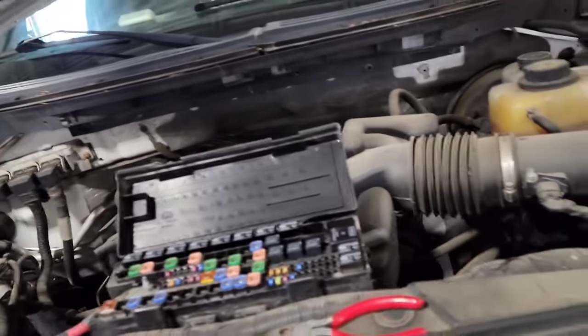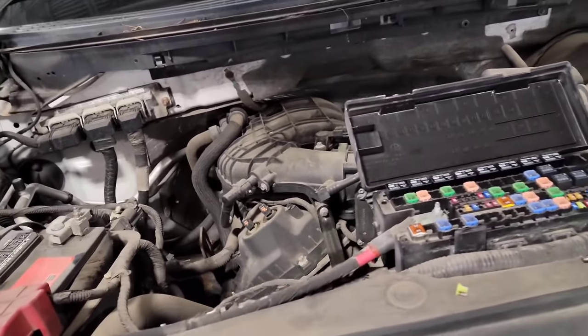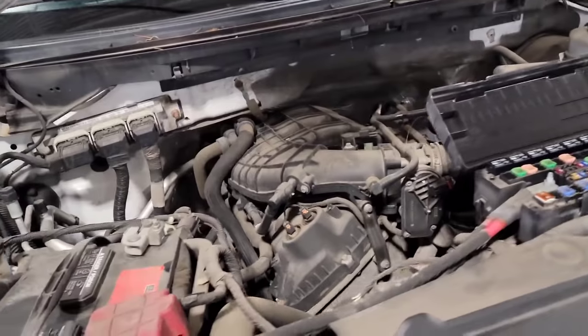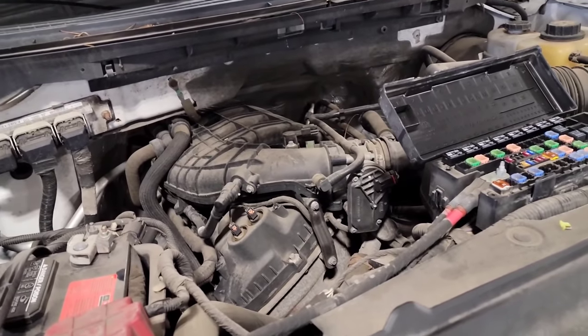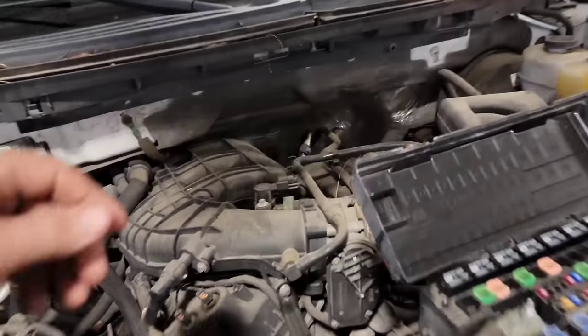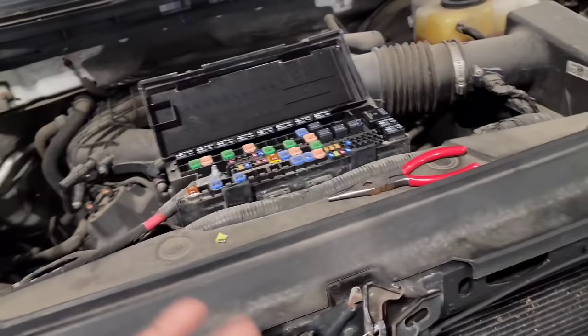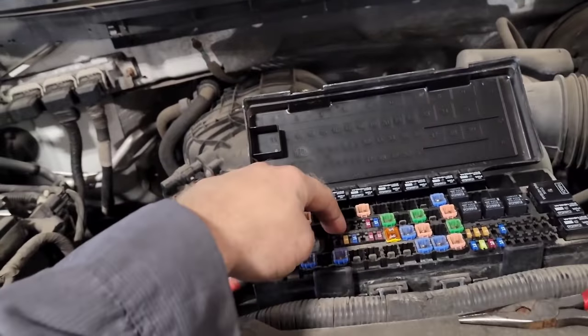But I'm concerned about that tank being sucked in like that. Normally when the tank gets sucked in that much, the tank is typically damaged. The fuel level doesn't ever read correctly, and you'll never get the tank straight again. A lot of times this purge valve is what's bad on these, but normally it's a couple things. It's this fuse, the kick panel down here where somebody pushes up against the plastic.